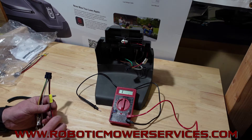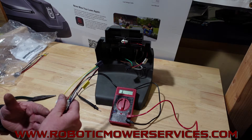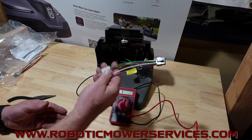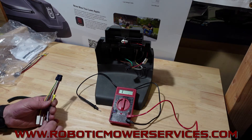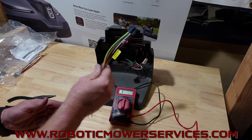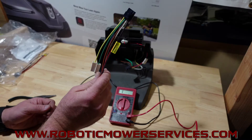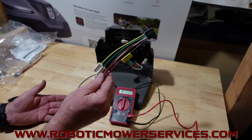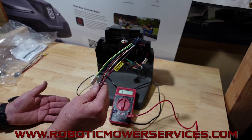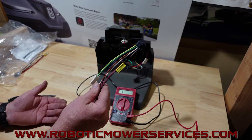The reason why I want to show you this is because if you have a problem with your charging station — let's say you have a no loop error, or you have a problem where it's something to do with not getting enough power through everything — you want to test this harness inside here before you just jump to ordering a new circuit board, because this is much less money than a new circuit board. It's always good to check this, because if there's a possibility of saving money and it's not going to cost you anything to find out, why not do it?